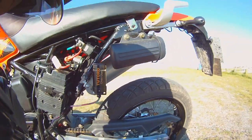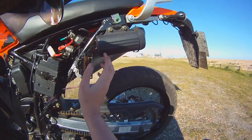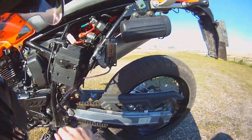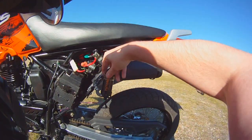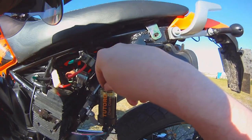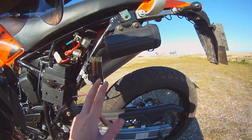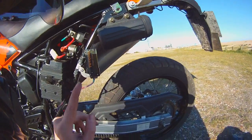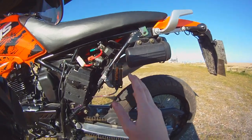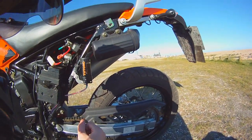I'll explain exactly how the thing works, because this is what I didn't really get at first. You've got a reservoir of oil, a tube that comes down, and a nozzle that feeds it onto the chain. Inside, if I pop this top off — it's a push fit but a good fit — you can see this brass bit at the top, which is a weight. As you ride up and down the road, it bumps up and down by about a millimeter, allowing oil to flow through the tube. You control the flow rate using this screw, to get it just right for your type of bike.